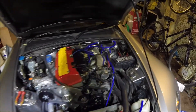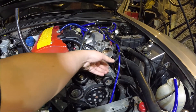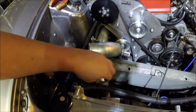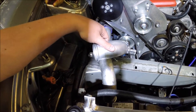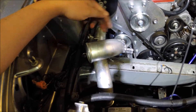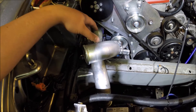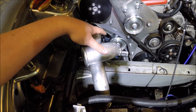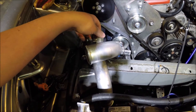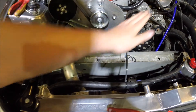Basically what's going to happen is: if you look at the throttle body there, there'll be a silicon elbow that will come across, the charge cooler barrel will be mounted across here, and then we'll turn into this 51mm pipe. This pipe here — the hot pipe — I'm going to put the blow-off valve there so that it vents the hot air from the compressor when I'm on bypass, meaning I'm not wasting the charge cooler's efficiency by constantly heating up hot air I'm not going to use.